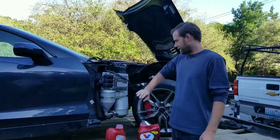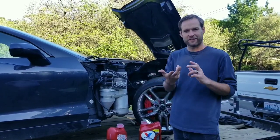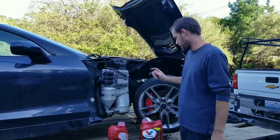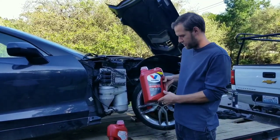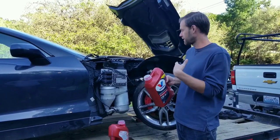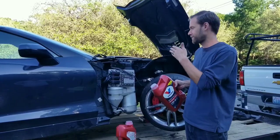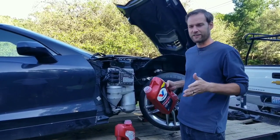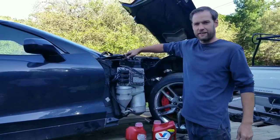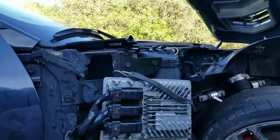We got this oil canister buttoned up — all the bolts back in the oil pan, new filter on, filter filled up to the top with fresh oil. I'm just going to use the synthetic blend, the cheaper stuff, because I find I'm changing this after about 10 or 15 minutes of running it — flush it out, then we'll put the full synthetic back in. It calls for about nine, nine and a half quarts, so I'm going to put nine in and go from there.